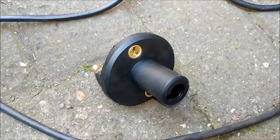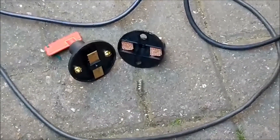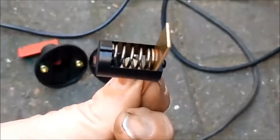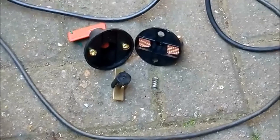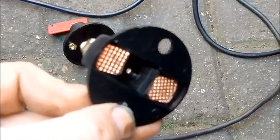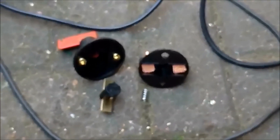There's this new one. Before we fit it, we'll take a peep inside. There you can see what's inside: a contact which is on a spring carrier, a spring to make sure it goes down when you take your key out, and the actual contact points — which are pointy. Not much of them. I need to keep water out of this one.